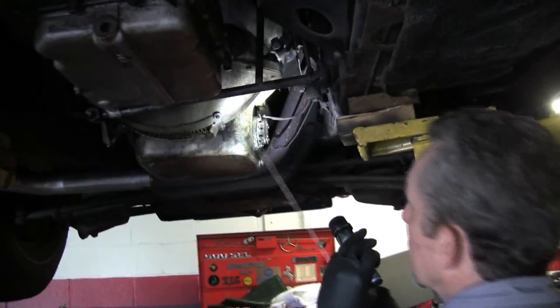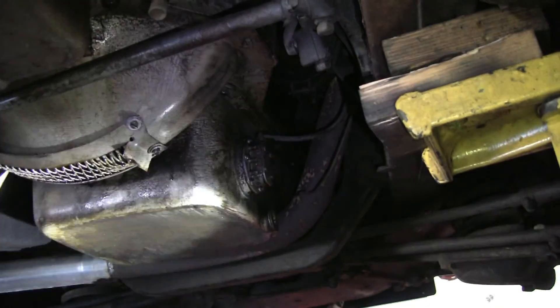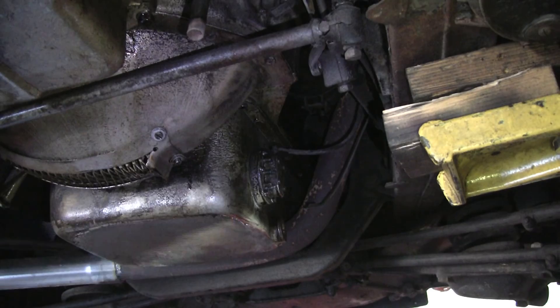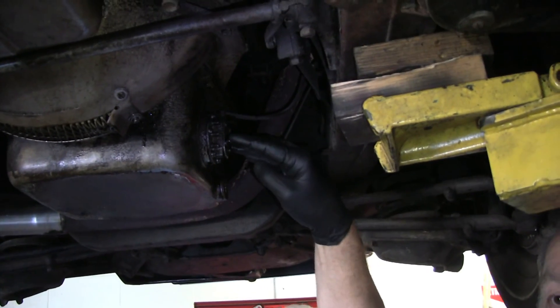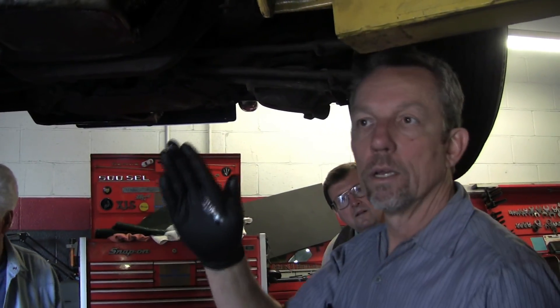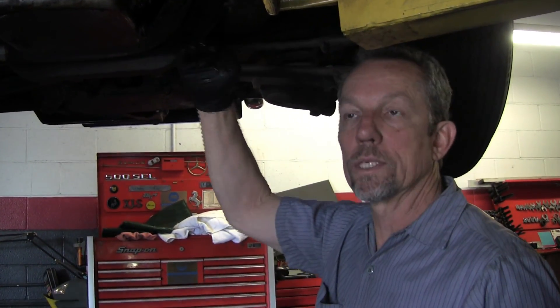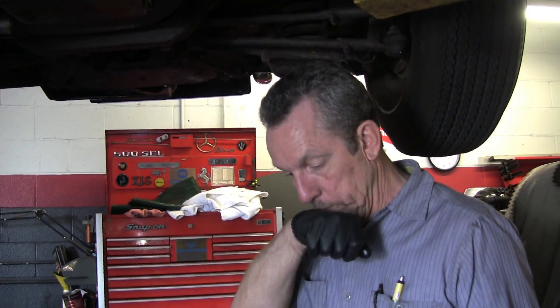Here's a real common area of leak — this is a sending unit for the oil pan. On these cars, the fuel gauge doubles as an oil level gauge. You have a test button you can press that connects to this unit, and on your fuel gauge it'll show a minimum oil line in orange. You don't want it to go below that. You have to turn the key on to check it, but don't start the car — just like with a dipstick, you don't check it while it's running because it's not accurate.